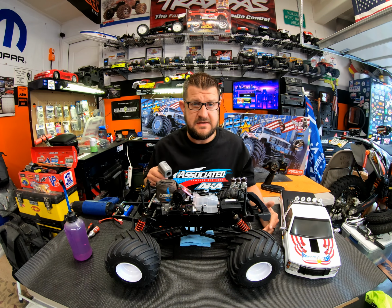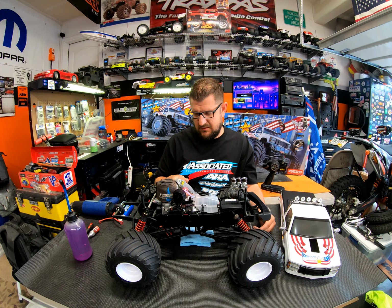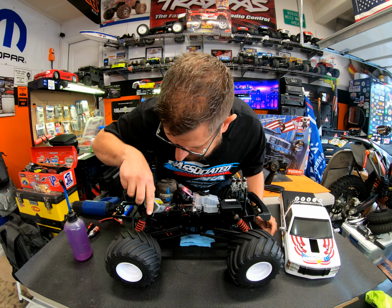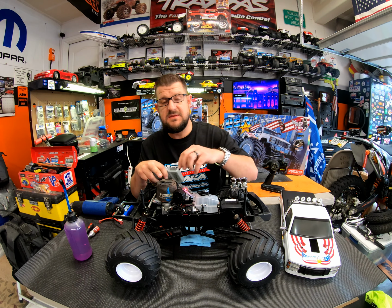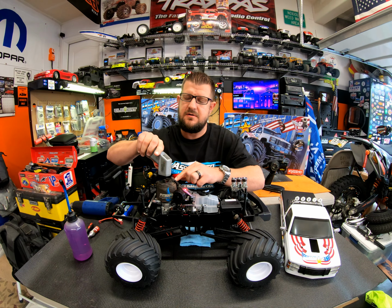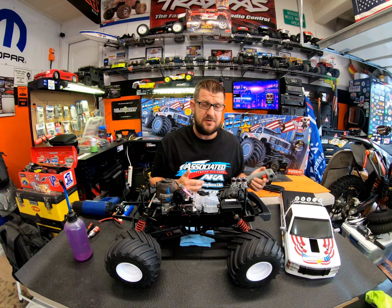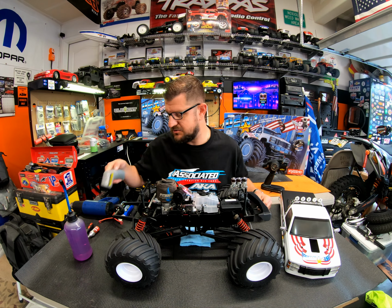All right, so I've got some pretty good heat scrubbed into the engine. I'm going to check it with my temp gun. So you can see I'm 120 on the engine block, which is great. That's perfect. And I always check both sides, and that's good. These engine heaters have a cool little glow plug hole in the top, so you can get your glow plug in there and also your heat gun. And we're also 120 on the cylinder head. So that's a perfect temperature to fire it up at, especially given my ambient temperature here right now.